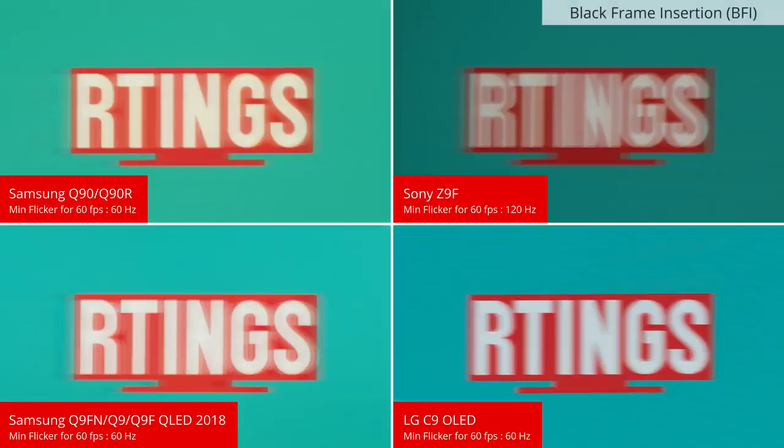This small amount of smearing is visible on the left-hand side of our moving logo photo as a slightly darker region. If you want the lowest amount of blur when gaming, then this TV also has the option to adjust the flicker of the backlight, a feature known as black frame insertion. It works well, as this TV can flicker at 60 FPS, which is good for avoiding blur or duplications with most 60 FPS games. The effect of this is clear when looking again at our moving logo photo.